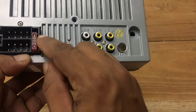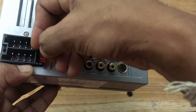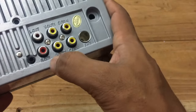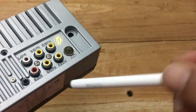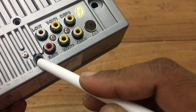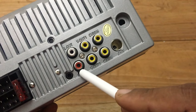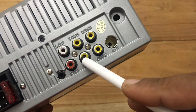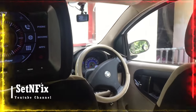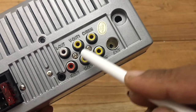In this power interface, the power cable and audio cable ports are there. You can connect the power cable here and the audio cable here. This is the main fuse. You can remove the fuse like this for replacement — use a 10A fuse to replace. This is the 3.5mm AUX input; you can give audio signals to the device using this port. You can see more connectors here: this is left side audio output and this is right side audio output. You can connect this unit with a power amplifier using these connectors. These yellow color connectors are for video outputs. If you want to connect extra displays to your vehicle or install headrest monitors, you can use these connectors. This is for video inputs.